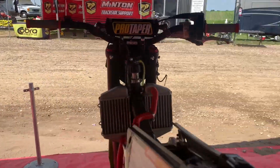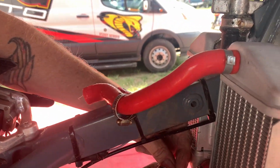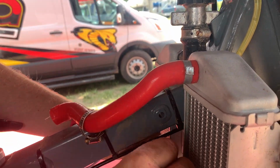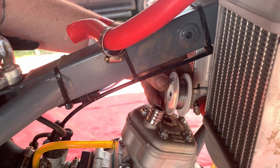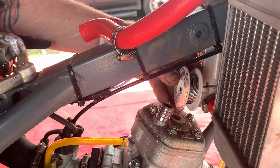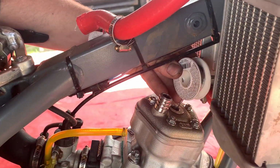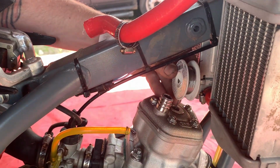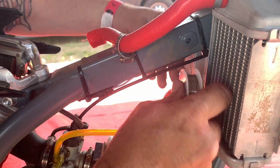So you watch what he's doing here. Let me do it from this side here this time. He's got that bent at a 90 degree. Gonna put it in there parallel right on top of the piston wrist pin. He's gonna kick the bike over 3, 4, 5 times. See what he's doing here. I like to move it around so I know I get it right at the tightest spot.